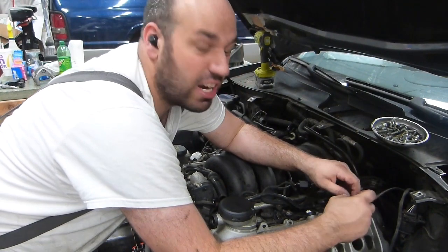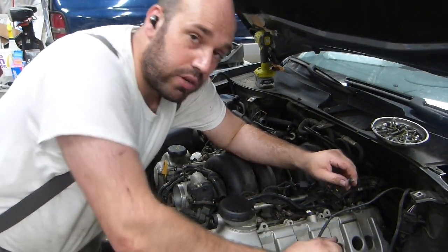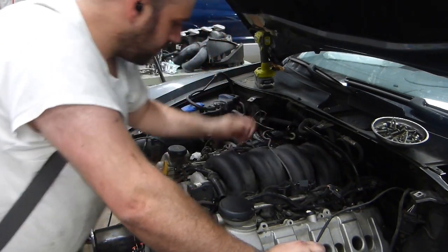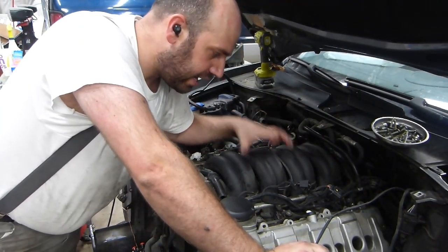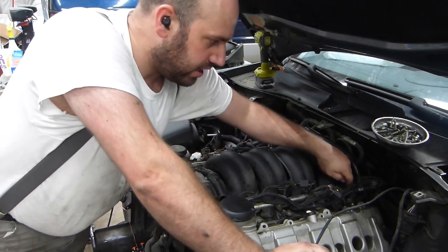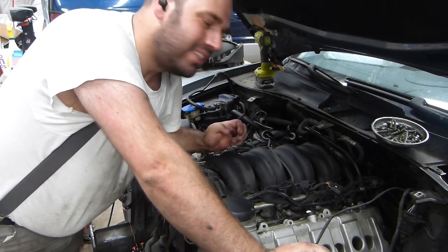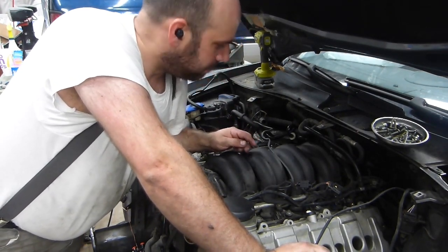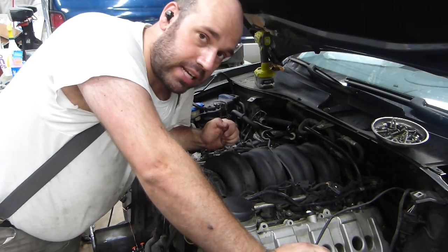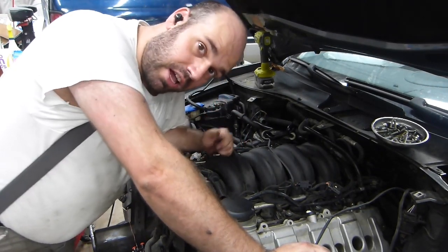Make sure you have a magnet and a stick on hand. Honestly just take stuff apart — it hasn't been that bad. Don't force anything; everything comes off pretty easy. I almost forced something off without taking the bolts off first. I'm not taking the plenum off — I want to try keeping it on. I think you can do this job without it coming off, especially since you can take these brackets off and take that crank position sensor off. The coolant hose underneath has already been done and there is an upgrade fix for the rubber — a Fernco fitting — but I'm gonna leave it since it wasn't done that long ago.